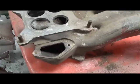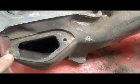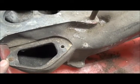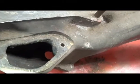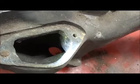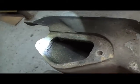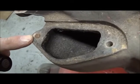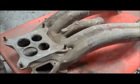First thing I see: we've got a broken bolt there, and this one's alright. These are very small bolts and they are so easy to break. The holes they go into are blind holes, and after years of heat cycles and corrosion these things will snap right off and then they'll have to be drilled out. So this one's got a trip to the machine shop for that.